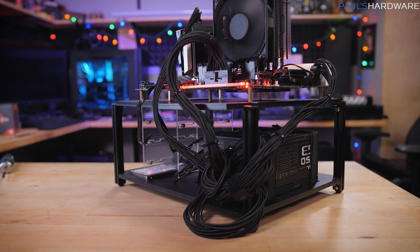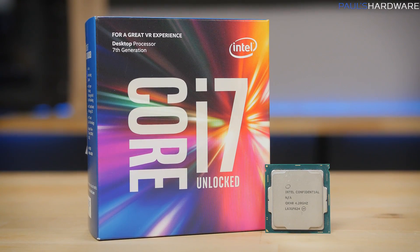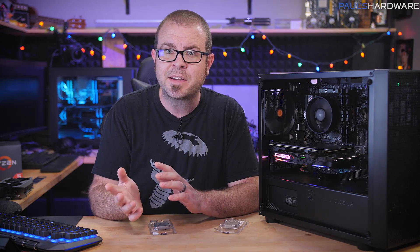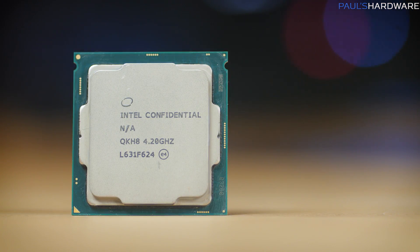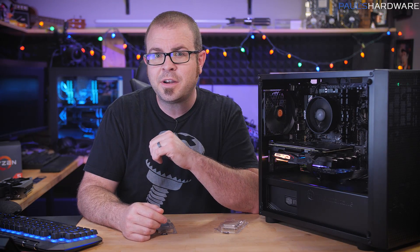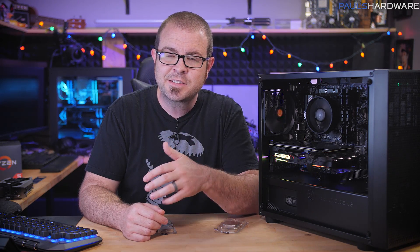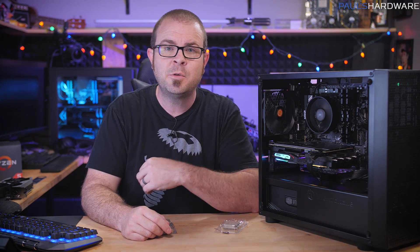The other rig is based on the Intel Core i7-7700K. I chose this comparison for several reasons. First, there is no desktop 4-core 8-thread CPU option in Intel's 8000 or 9000 series — Intel moved to 6-core CPUs without hyper-threading for their mid-range. Also, the 7700K is still on 14nm and effectively has the same single-core performance at the same clock speed as an 8000 or 9000 series chip. It launched in January 2017 for $340, making it a great benchmark for how far we've come in three years.